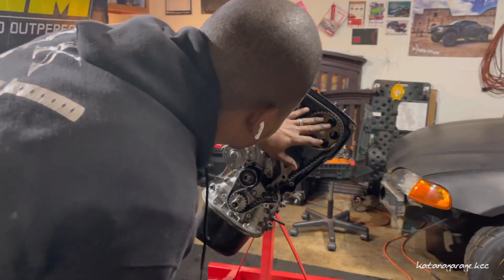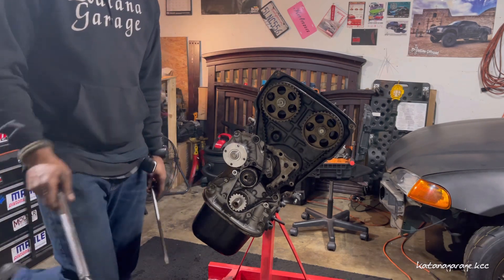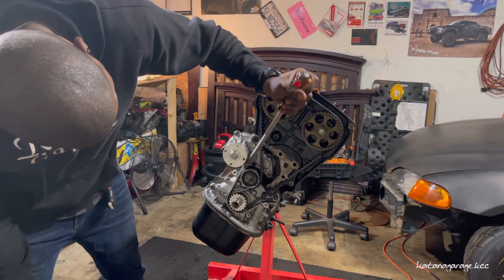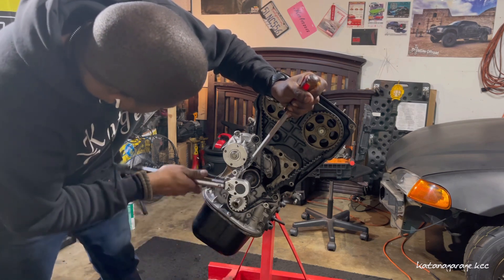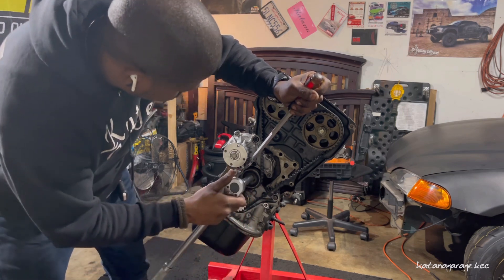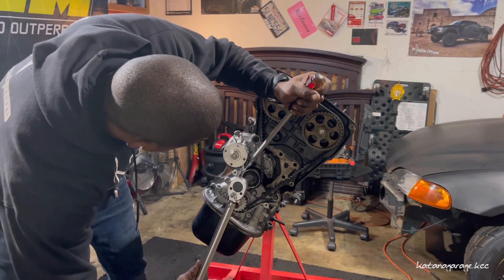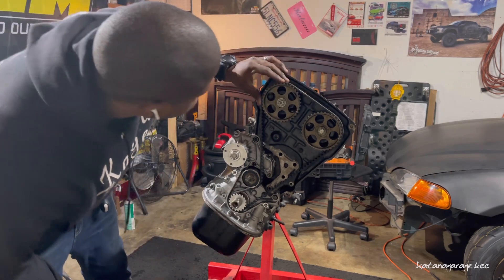Now that you've verified your marks are still in position and nothing has been rotated, go ahead and grab yourself a big flat-head screwdriver, a 14 millimeter deep socket, and set your torque wrench to 27 foot pounds. You're going to gently pry the tensioner forward and torque the bolt. Run it down a little bit — going to 27 foot pounds — just like that. You're in time now.